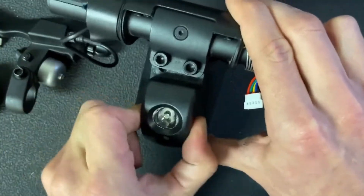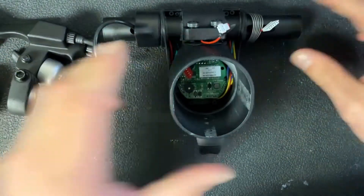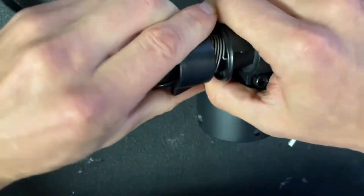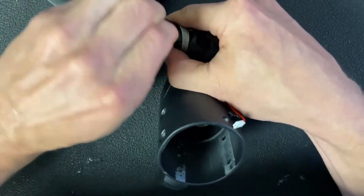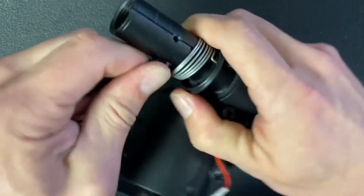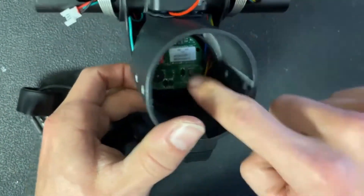The headlight slides right out after you loosen those bolts, and the connection point is right there. Once you have the throttle and the brake handle off, you can go in and remove the panel. Slide the cover off so you can fully disconnect the brake handle. The connectors for both the brake handle and the throttle can be accessed through the interior groove. We'll be replacing all these cables as we swap this piece out.